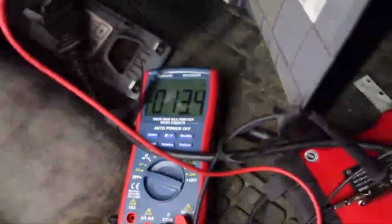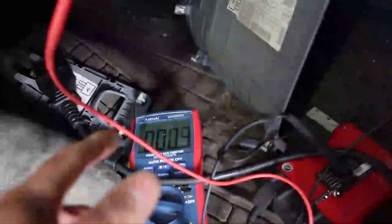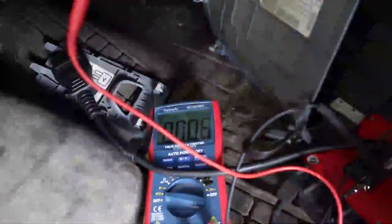And this is interesting because this circuit is showing low. And when a hazard switch is depressed, it doesn't change. So I'm definitely on the circuit. The best I can tell, I'm about to cut this wire. I hate to cut a wire, but I wanna verify that nothing else is going on up in there. I want to see if our voltage goes high, because it very well could be just a shorted hazard switch, which I'd be surprised about.